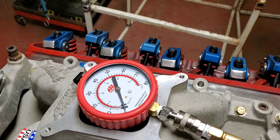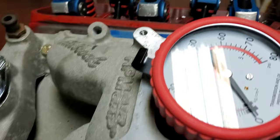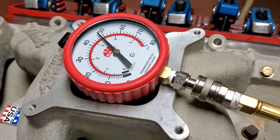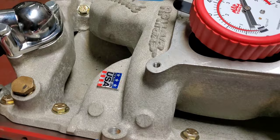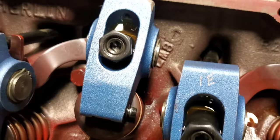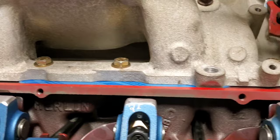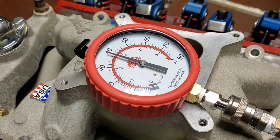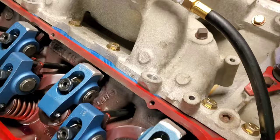We've got everything hooked up and we're going to start spinning the drill. It'll take a little bit from when we start to actually getting pressure because it has to fill up the filter and everything. With the drill going we got almost 60 psi. It took a little bit, but you can see we got oil coming through every one of them — had to get all the air out of the lifters since they were brand new. Once we hit the trigger we're getting 57 psi and the oil starts flowing instantly. This motor is basically ready to drop in now.